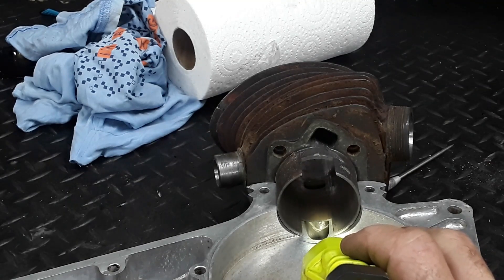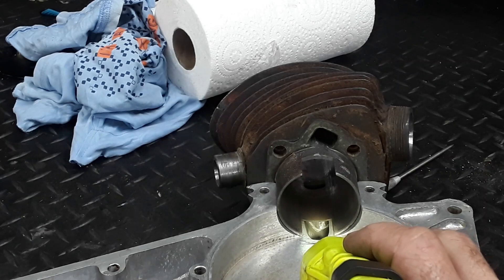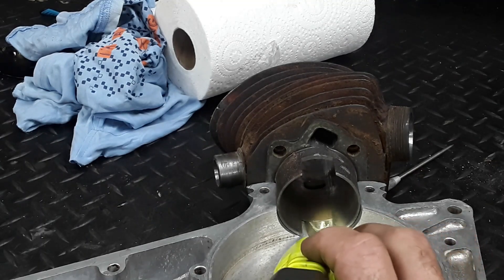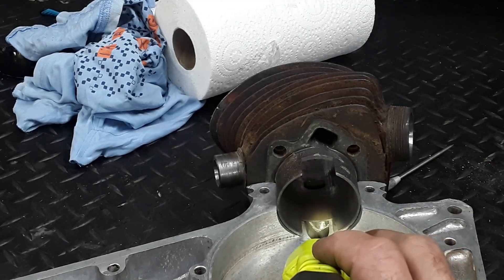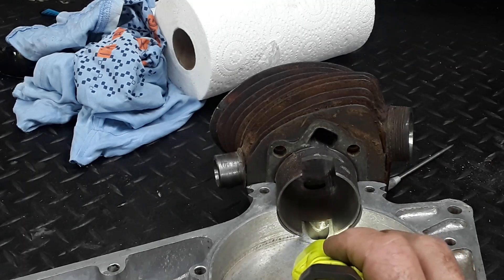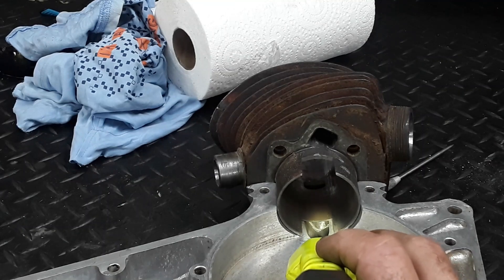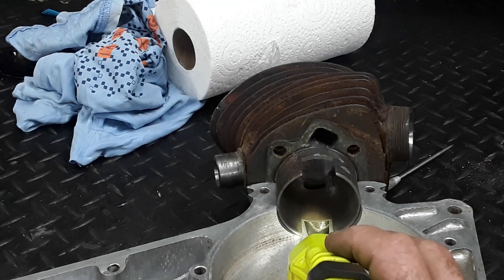We've got the barrel over on the left hand case and as you can see, you can see how much of the transfer is overhanging into the case transfer. I've scribed the line around that — on this side we're not taking meat out of the case, we're actually taking it out of the transfer to blend it in to marry up. That's the sort of stuff that the Japanese don't do — all their stuff's spot on. The little Bantams actually respond well to cleaning all this stuff up and getting it all blended. I'll tell you right now, it's not going to make 10 miles an hour difference but it certainly makes them go a lot better. These are all the little 1% things you can do to make your engine run really well.